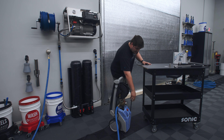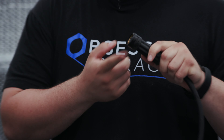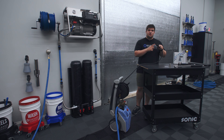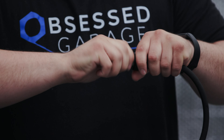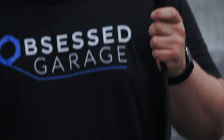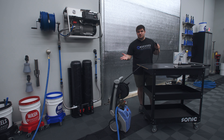Let's move on to the high pressure hose. The 1122 makes this pretty easy since it's integrated into the unit itself, but you'll see here on the end it's actually terminated in an M22 fitting. This is pretty normal for portable units or basically any OEM hose you'll get, but we do need to convert this to a quick disconnect. Included in the kit is an M22 coupler — the Mozmatic one, so it's compatible with all the other Mozmatic quick disconnects. We just screw this into the end of the hose. This is another O-ring fitting, so we don't need any Teflon tape — just hand tighten it and you shouldn't have any leaks. If you do start experiencing leaks, the first thing I'd recommend checking is either the O-ring inside of the coupler or the O-ring inside of this connection.